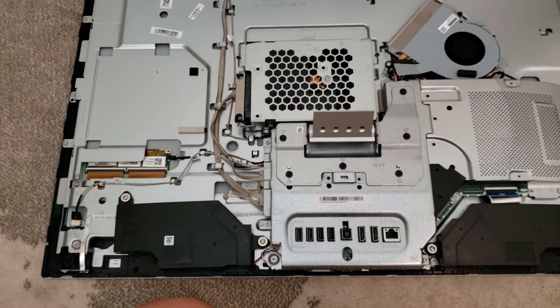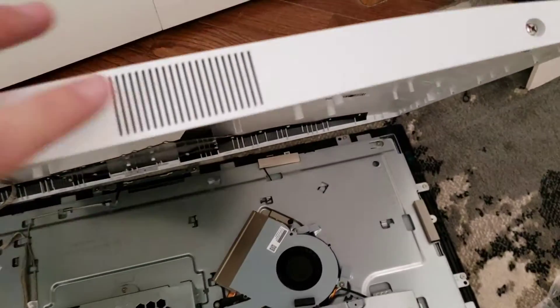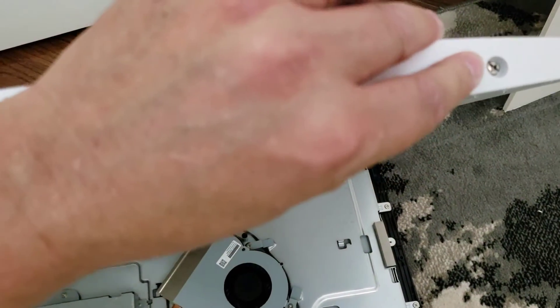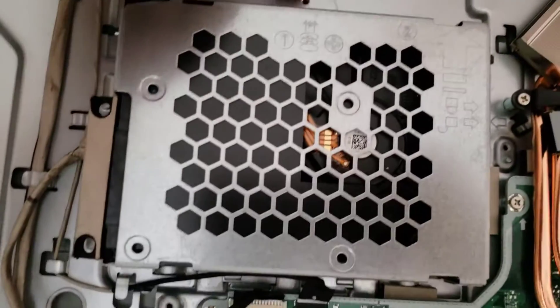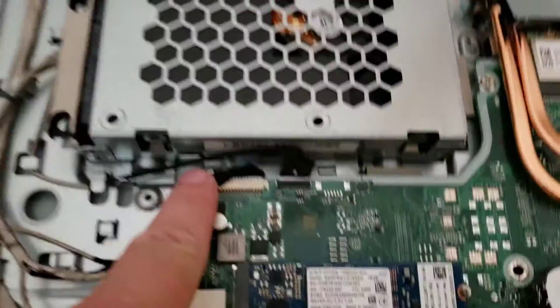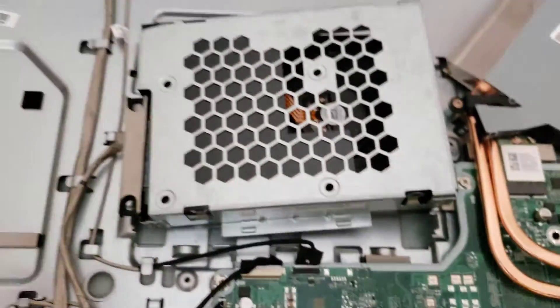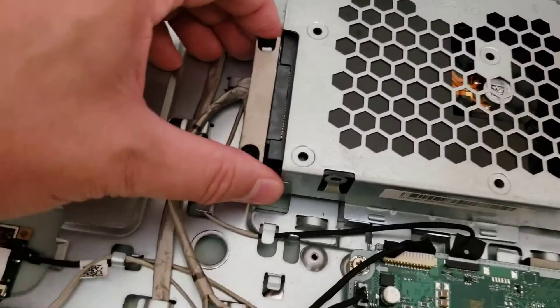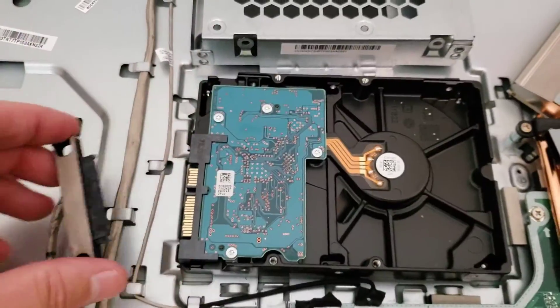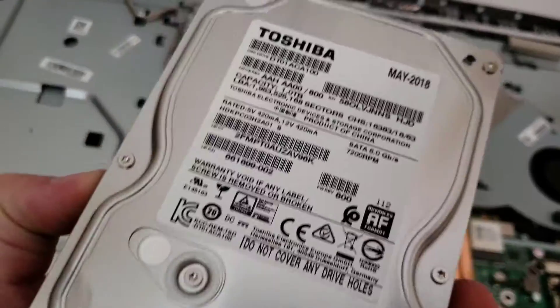The last thing I want to point out is that you don't fully unscrew the little screws here — you just turn them a quarter turn, half turn, and you'll hear it pop. That's what it is right there. There's also a screw there which I pulled out, and you can see the mount is hooked in, so we just slide it out. There we go, it just pops out nicely. I've got the SATA connector off. The housing came right off.